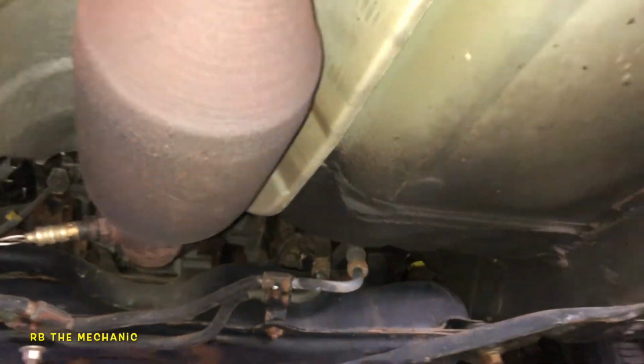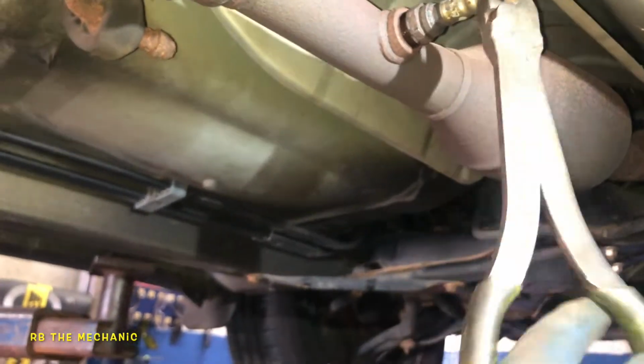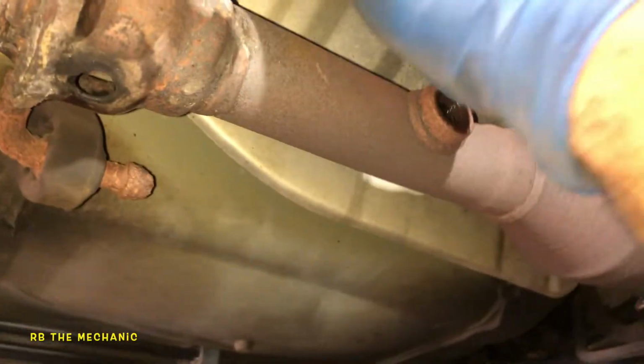Okay, so just pop it loose. I'm gonna cut this harness off because we're gonna replace the sensor completely, and I'm gonna push in the new harness, and then it's gonna be right by the under the seat, and we will get in there. We might have some water in here because this car was kind of flooded, but it has all steamed out of there. So I'm gonna cut this sensor off for a second. Okay, got my splicer cutter, and we're gonna go down here. My light isn't helping, and like I said, this sensor reading is what the computer is gonna try to determine. Okay, it's all dried up inside there. So it's perfectly fine. And the computer is going to try to determine, according to the reading with the sensor, is it good or is it not good?